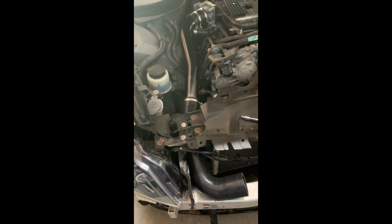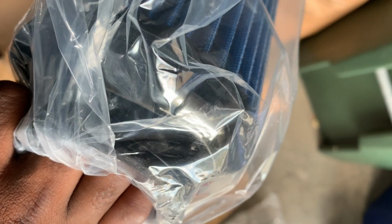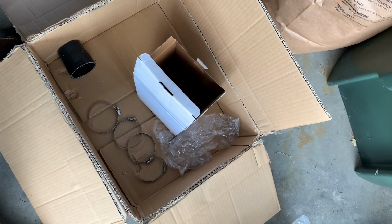Made it to the piping, and don't forget to preload one of these couplers, otherwise you'll be pretty mad at yourself. So look at that compared to the stock filter. New in the bag. You can see my kit came with an extra clamp for each air filter. Then you got the union, the barb size, what goes in the filter. But it looks like I'm gonna have some extra clamps because I've got 5 left over. All good.